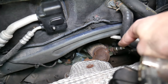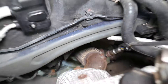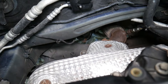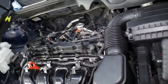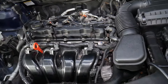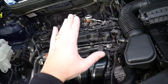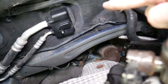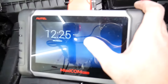Don't touch the exhaust — let the car sit overnight before working on it. The first sensor, which I've got loose here, is the upstream oxygen sensor, also known as bank one sensor one. Its purpose is to detect how much air and fuel is in the exhaust manifold, send that information to the engine computer, and help determine if the mixture is rich or lean so the engine runs cleanly and meets emission standards. Bank one sensor two, the downstream oxygen sensor, is the second sensor — installed on or right after the catalytic converter.